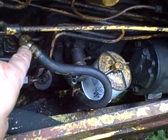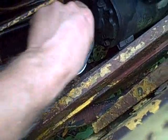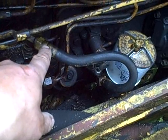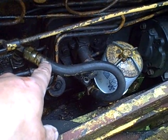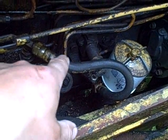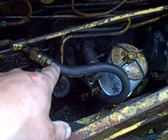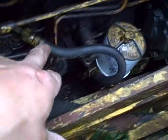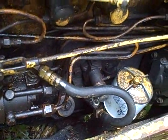I know I'm getting fuel here, but I'm wondering how much. A little bit of fuel is coming out right now. So what I'm going to do is disconnect this line, put it into a container, activate the electric pump, and see just how much fuel flow I'm getting. If I'm getting plenty of fuel flow up to this point, then I can stop worrying about the hand primer or a blockage and go after this area here, because I still believe it's a fuel issue.